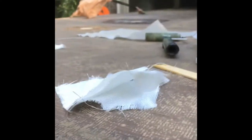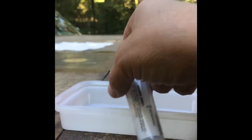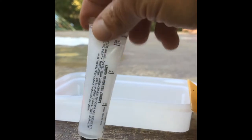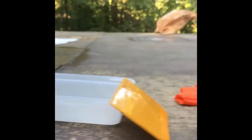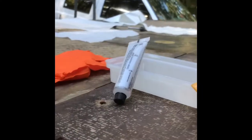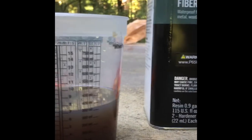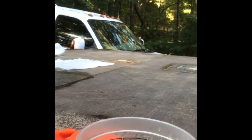The carpet and seats are on the way — it's just gonna be waiting on me at this point. I've already got some resin mixed and I'm going to add the hardener now. I quartered up the can — you get two tubes of hardener per gallon of resin. Mix it according to spec and you'll be fine. You've got eight to twelve working minutes, so you have to work kind of quick. I'll go ahead and mix it in and show you how I actually plug that hole and work the resin.